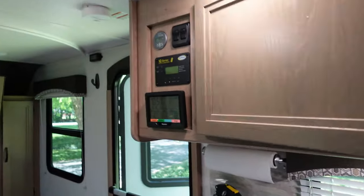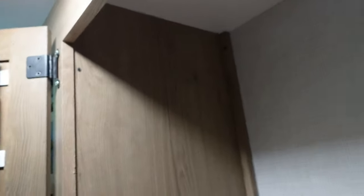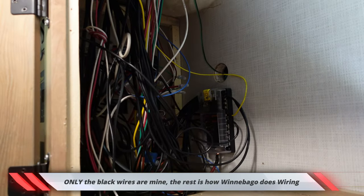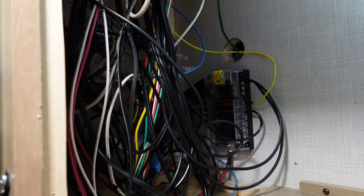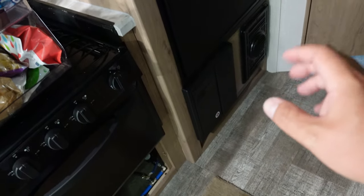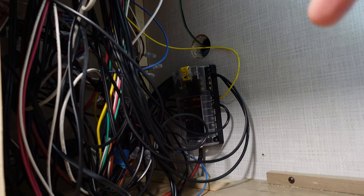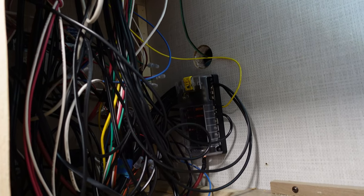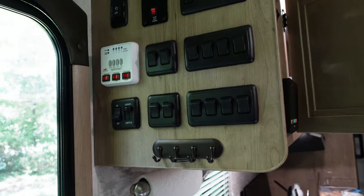Here's my kitchen and pantry. I'm going to remove this panel — right in there is where all the wires come in from the ceiling. There's one entry and there's the other one — that's where all the wires come in. When they come in, I have installed an additional fuse box here. Every accessory I've added goes through this fuse box. There is a fuse box in your breaker panel for the 12-volt accessories, but that's not enough fuses for me. So everything goes to this one because all the switches are here — the wire goes straight into the fuse box and then out to the switches.